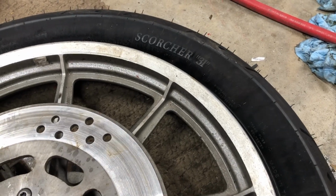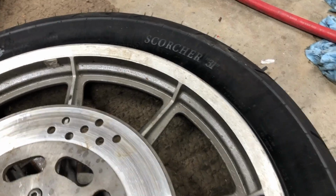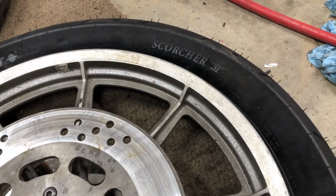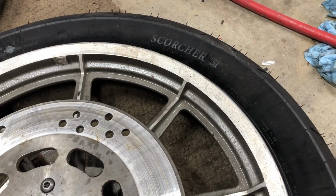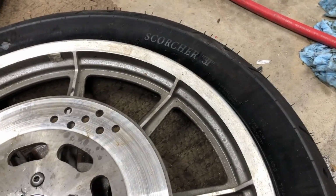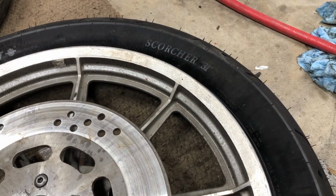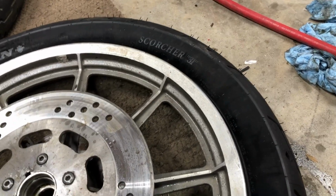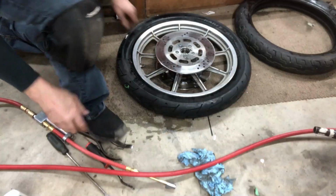And you can put in, I'm being told, up to a maximum of 90 pounds of pressure. I hate to do that on an aluminum rim in case it blows it apart, but to get it seated... Often I don't like to go over 60 or 70 PSI in there, and that often works, especially when it's wet. But if you let the air out a couple times, put some more lubricant on it and then blast it back up to 60 or 70, it'll seat and it'll often pop like a big bang. We'll keep going here.